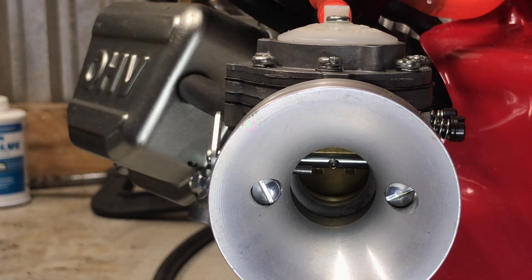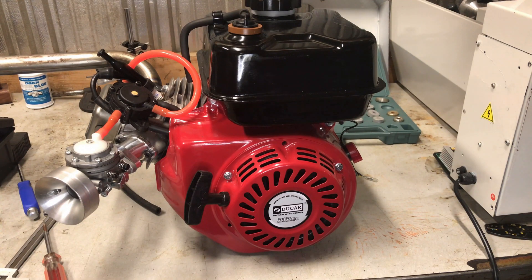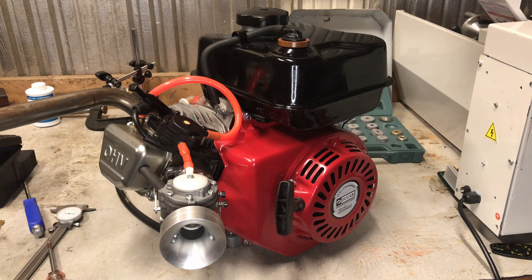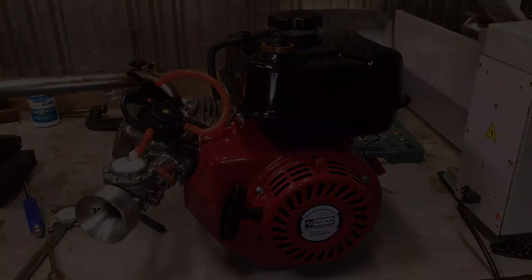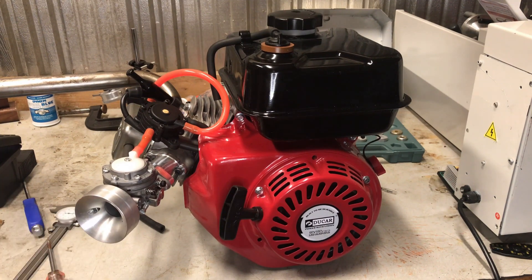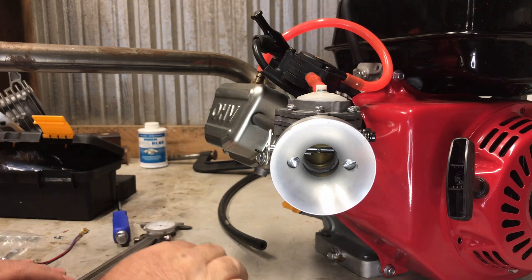These little $14 Tillotson clones are really great — I really like them. If you want to use one of those, that's the 302 VS, and it's about $24.99 — right at $25, that's not bad. It is billet aluminum, so it's a nice part. I'm not going to leave this on permanently — I just stuck it on here temporarily to get some idea how it fits. You won't be able to use the little carb air cleaners off the VM22; it's way too small. Just any standard two-and-a-half inch ID go-kart air filter would be perfect.